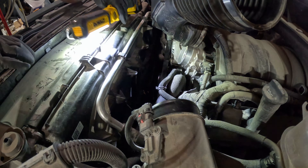Check out the links in the description below for some of these products. The belt I picked up at Napa seems like a high-quality belt that fits right on there. Use four to five zip ties — I used four and got it on without breaking any, but the arms take a toll, so get yourself a longer wrench. They quoted me around $250 just to replace the belt; I bought the belt for $30 and it took me about an hour, including taking it apart and cleaning up. Thanks for stopping by — hope you found this video informative and helpful. Catch you on the next one!